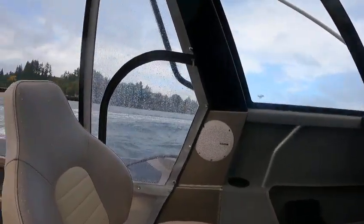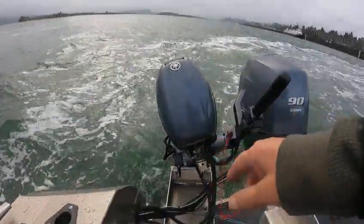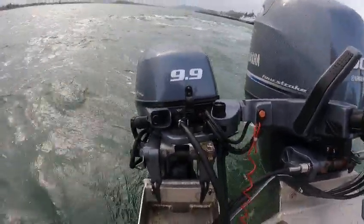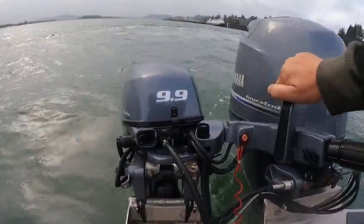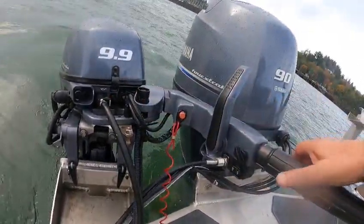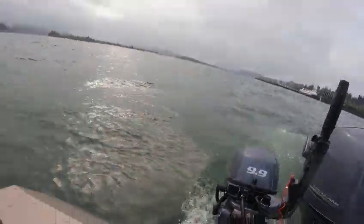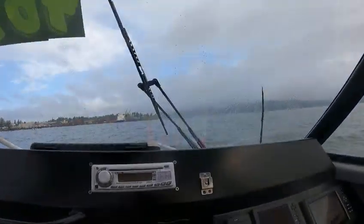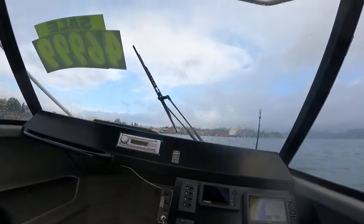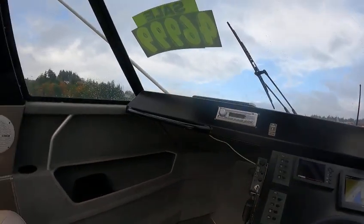We'll show you the kicker motor. I'll turn it off. When it's cold, you always pull the choke out, put this in gear, give it like three pumps — womp womp womp. When it's cold, bring that back and line it up. When it's warm you leave it there and hit the button, bring it back, put it in gear. It does between five and 6.9.